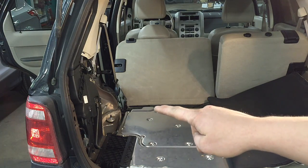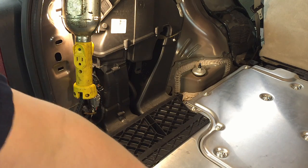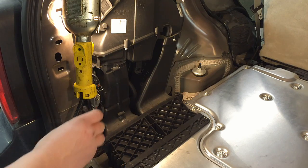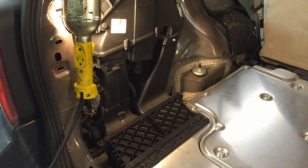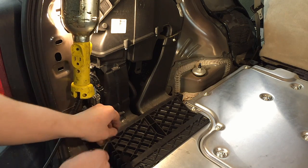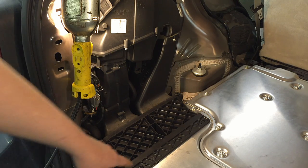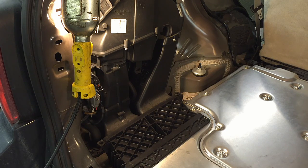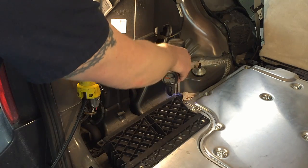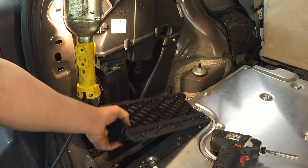That was probably the hardest part of the job — getting these trim panels out of the way. Now all you've got is the actuator and some ductwork. Next, get the airflow ductwork right here out of the way — it goes from the HVAC case over to the traction battery. It has a couple of 8mm screws and one scrivet. Use a Phillips head to back the scrivet out, then remove the screws. There are four 8mm screws total, and then the whole thing lifts right up and out — it's literally just a pass-through.